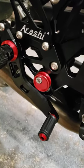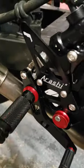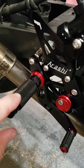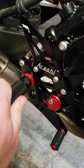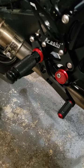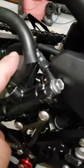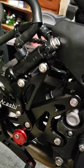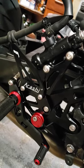The only difference these have compared to standard OEM rear sets is that these flex a little bit more. The rear sets on my 600 flex a tiny bit; these flex a little more than those. It's a smaller bike — this 400 — so I don't think that's going to be a big issue, but for some people it might be if you're 200 pounds or more. I also had to lift the rear brake line to give a little extra slack because these have more of a forward tilt with the back brake master cylinder.